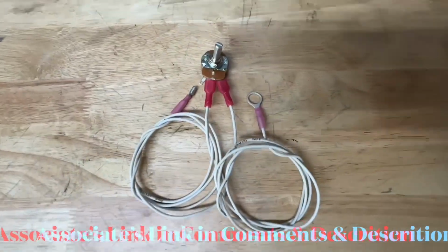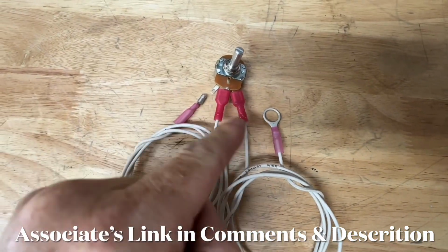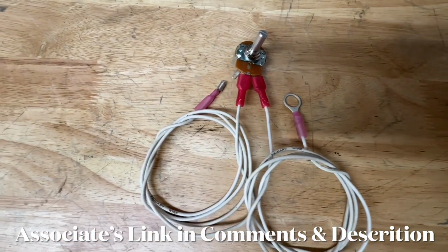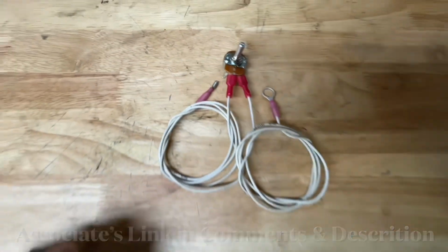Okay, so the way that we're going to eliminate whether the issue is with the sending unit or the gauge itself is we're going to use this little 100 ohm potentiometer that I'm holding in my hand here. All right, so here's my little test rig. We've got a 100 ohm potentiometer, a couple of electrical connectors, a ring terminal for the negative side of the battery, and a bullet terminal to hook up to the factory Ford sending unit wire.